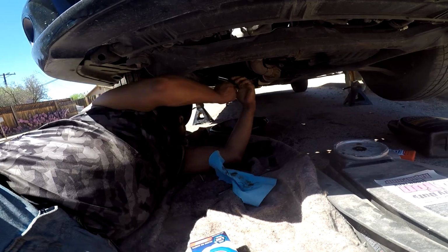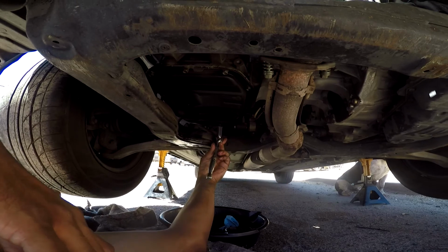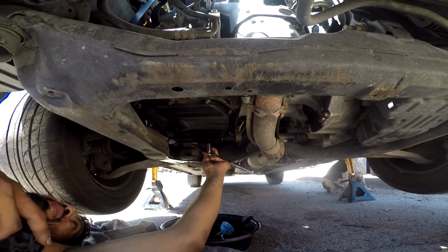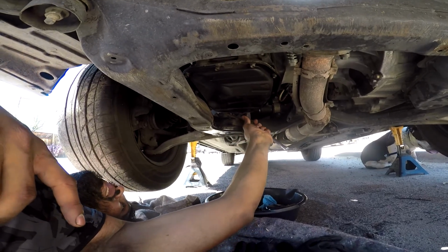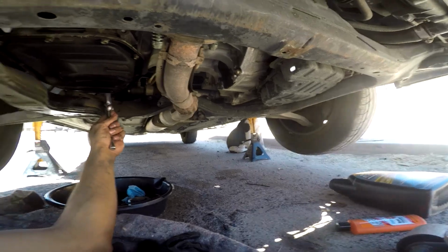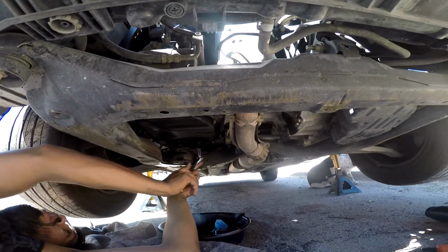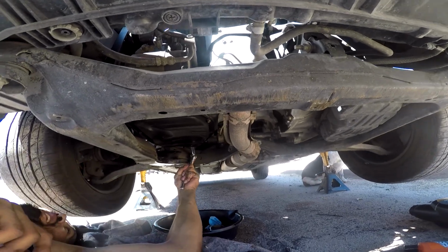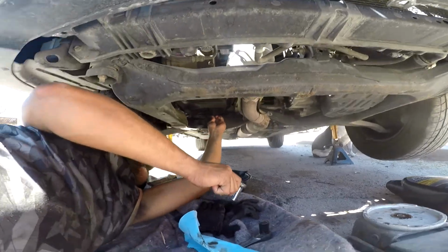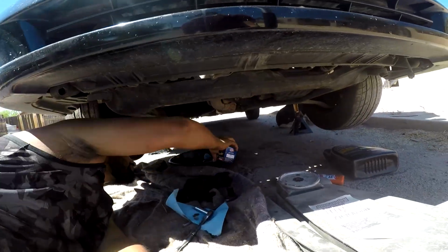And then the crush nut, you should be able to press it. You don't want to do it too hard because those oil pans tend to strip. So you have to tighten it, but not too tight. You can still do it if you put your strength into it, but if you can't do it with one hand, that's pretty good enough. Should crush. Good enough. Good seal.